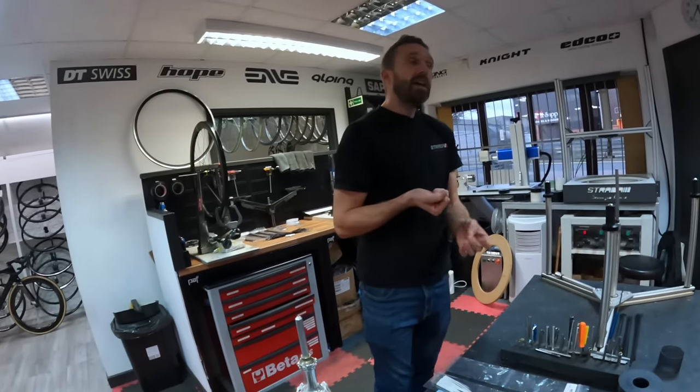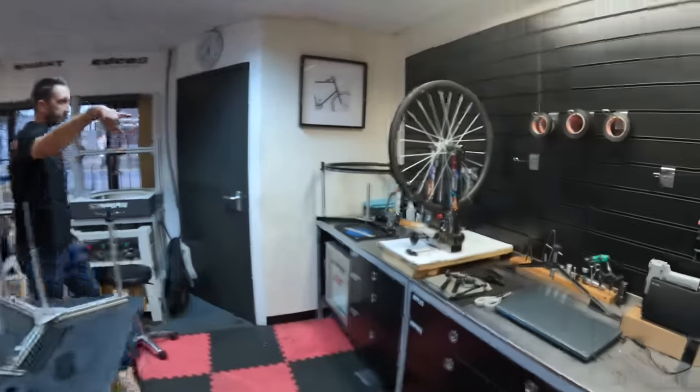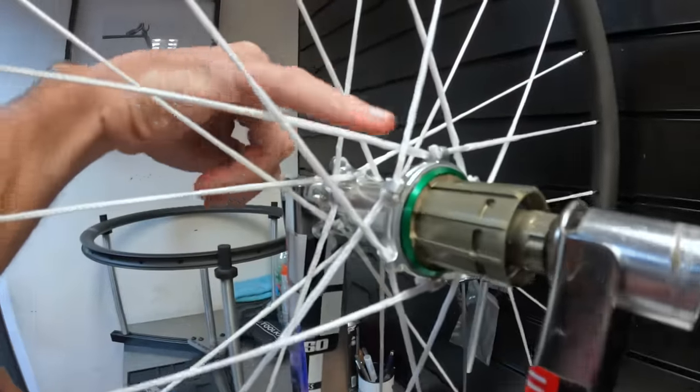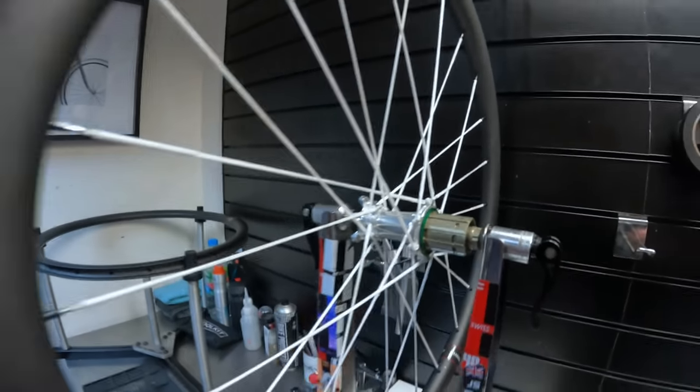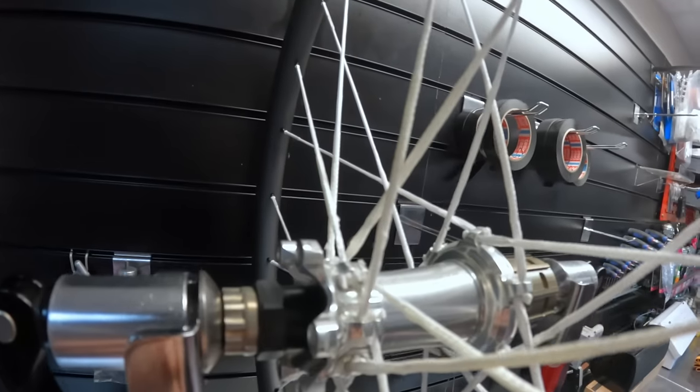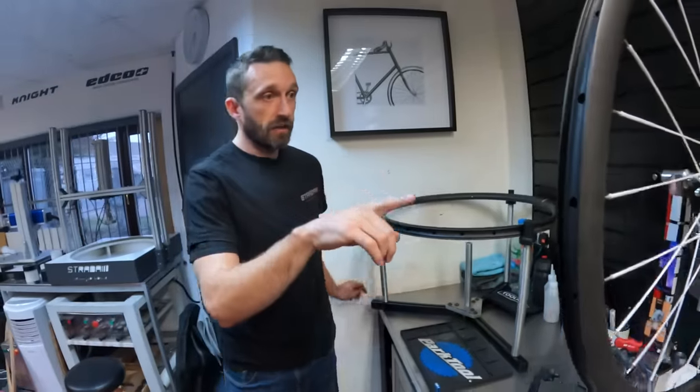At the moment the pegs are quite pronounced — you can see them on almost every single spoke. I'll keep an eye on these when we lace the wheel up. As we slowly bring it up to tension, by the time the wheel reaches its completed tension you probably won't see the pegs at all. That's why they cut the pegs at a specific size — the spoke tension is so tight that it draws the peg into the hub flange. You can see on this finished wheel there's only a small amount of peg left, it's almost gone.